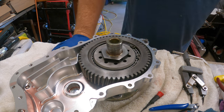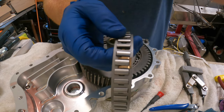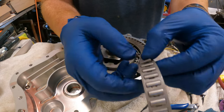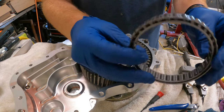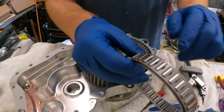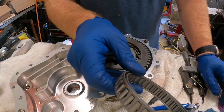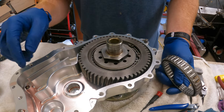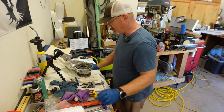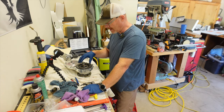It's not necessary to replace the clutch unless it locks up on you, except there are these little retainer clips. We've talked to Teal about this a bit. These retaining clips — there are four of them on here — I'm not sure of their purpose. This is a clutch out of a Turbo 400 transmission. Teal recommends leaving them in, but when I was changing the oil I found a piece of one of those clips on my magnetic plug, so it was recommended not to run it with those particles in there.